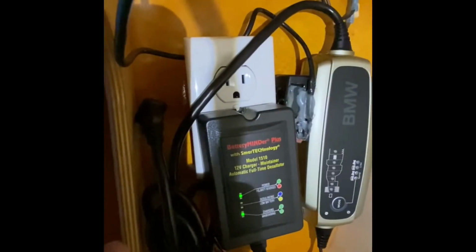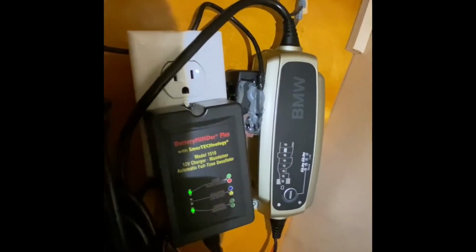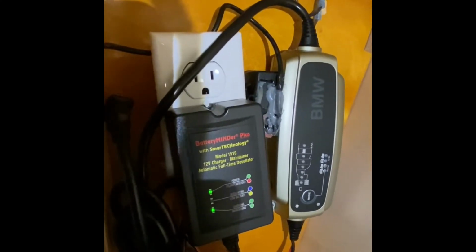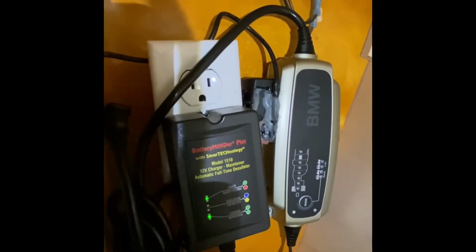If we find that we've had a couple of dull days and wet days, etc., when we're driving, I can switch this one off, switch this one on while we're driving, and along with the solar panels, which give anywhere between 0.5 amp to 3 amps, I think it is. We've seen 3.5 amps. We've also got this one that's going to give us 4.5 amps, so we can get quite a bit of charge. But this battery in the little trailer is only a 69 amp single lithium ion battery, so it recovers really quickly.